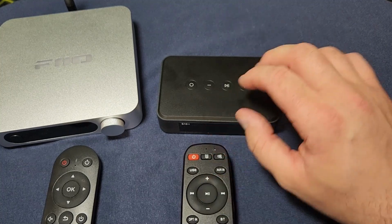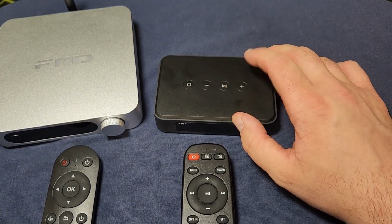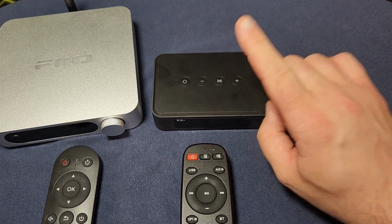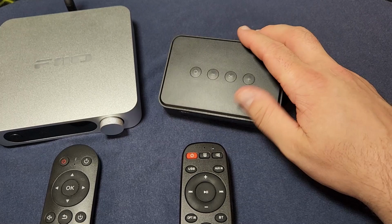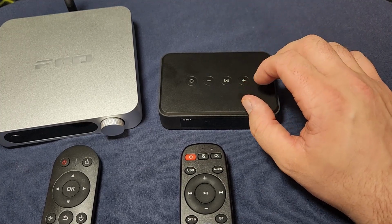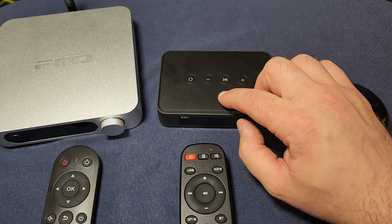Okay. Unique features about this one that are not so great, other than that Wi-Fi being capped at 2.4 gigahertz, as I mentioned a moment ago, is that this will only support CD quality audio output. So from the digital audio output here, and I believe also the internal DAC, it resamples everything above 44.1 kilohertz PCM files to 44.1 kilohertz, and then converts it from there.